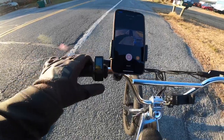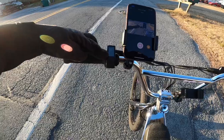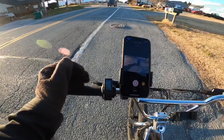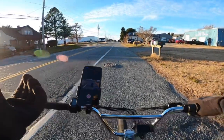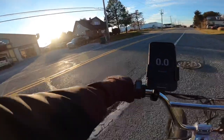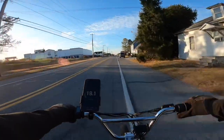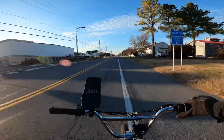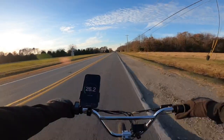Let's get started on the first ride and review of the Zeus Urban Ultralight 1100 — I'll see you guys on the road. What's cool about the display is it shows you the voltage if you touch the power button one or two times. It says 57.6 volts. With a 52 volt battery, a full charge is 58.8 volts. I'm not sure if there's some setting in the controller not giving us a full charge, or if something's wrong with the display. Anyway, let's start off with a full throttle speed test — getting the speedometer out. This is a nice straight road. 28 on display, 26 on GPS.